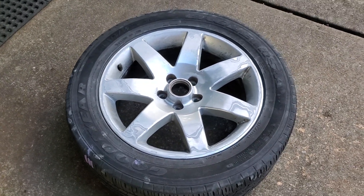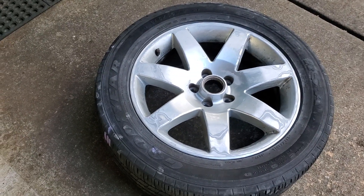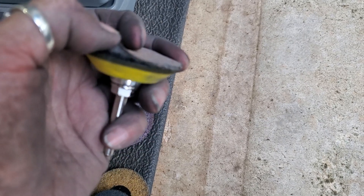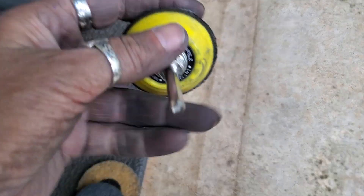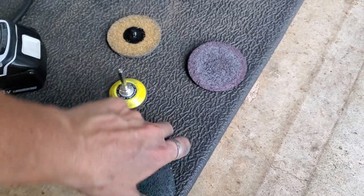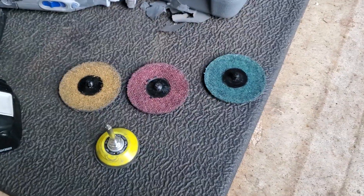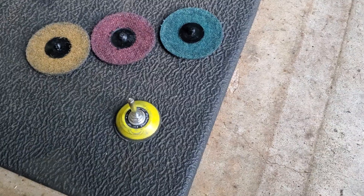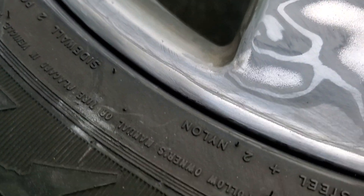I have been working on it since I filmed the other video. Ended up going with this little 2-inch 60-grit paper that goes on with velcro and then goes in the drill. Then I stepped up to the orange or brown scotch brite, then the red, and then the teal-blue aqua - going coarse to finer over the rim of the wheel itself.